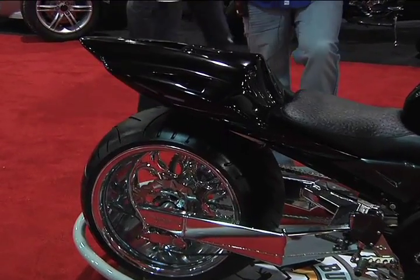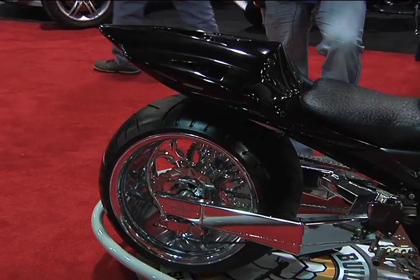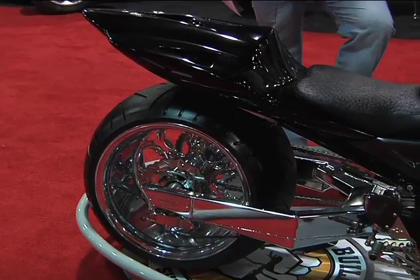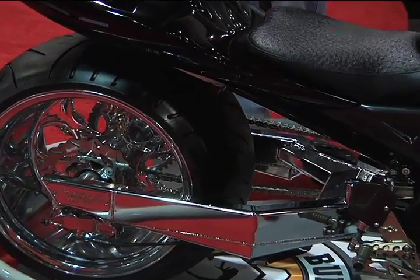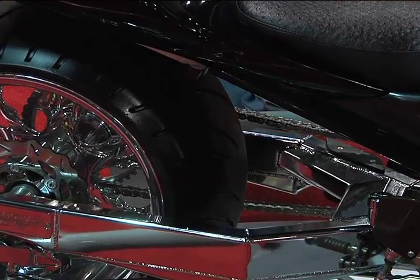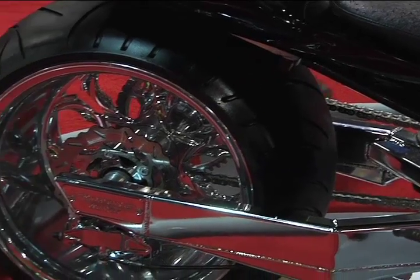A lot of the fat tire bikes, the fad's been going through, and the big negative with them was the jackshaft and having 2 chains. This bike here has a modified OSD system, which has a support plate that uses the frame swing arm pivot point to keep the output shaft from having tension from the performance or horsepower like this bike's going to make. So you have a 330 fat tire, you have 1 chain, 1 adjustment.